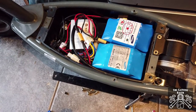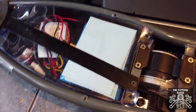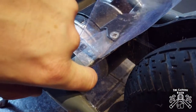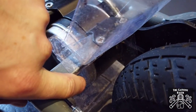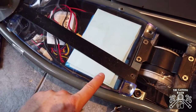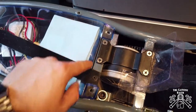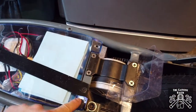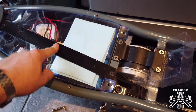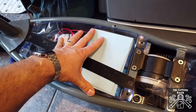One little addition I have added — you'll notice some plastic here and underneath here. This is just recycled packing plastic, but it stops the splashes that come from the wheel if you get caught in the rain — I live in England. There's also a plastic cover over here, again just recycled plastic tucked down through the hole, and then the bar goes over the top. Anything that sprays up could get into where your battery containment is, and then you've got a possibility of shorts — and we don't want that happening.